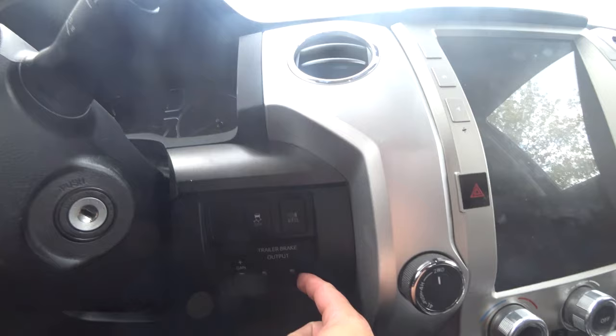And it's not a very smooth ride and it'll get herky-jerky and it'll pull on the ball and you'll feel it on your tow rig and that sort of thing. Always be ready to reach down to your emergency brake controller and hit that if you're worried you need additional braking power from your trailer brakes or anything like that as well.